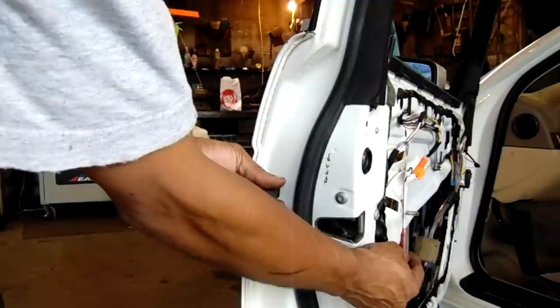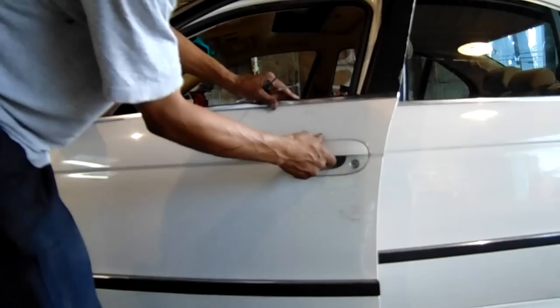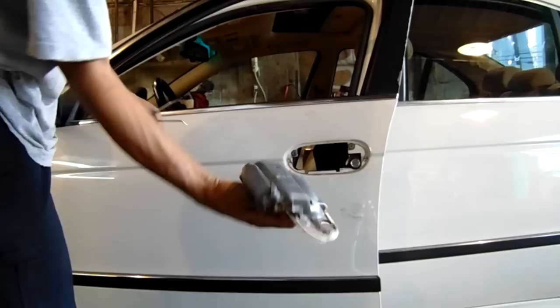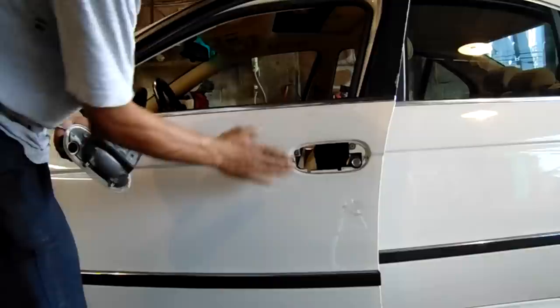What you'll do is hold the locking plate up — the little locking tab on the plate — hold that up and then just push this in. Once you do that, it releases the locks on the bottom of the door handle, and you can simply lift the handle up and out. That's one whole piece. When the handle's installed, the locking tabs lock these two pieces in, and of course that's locked into the top.